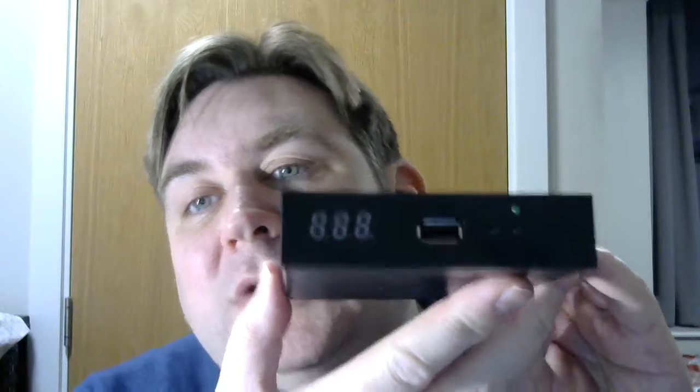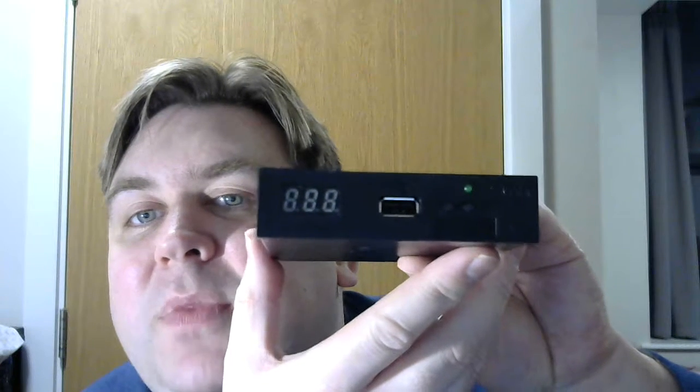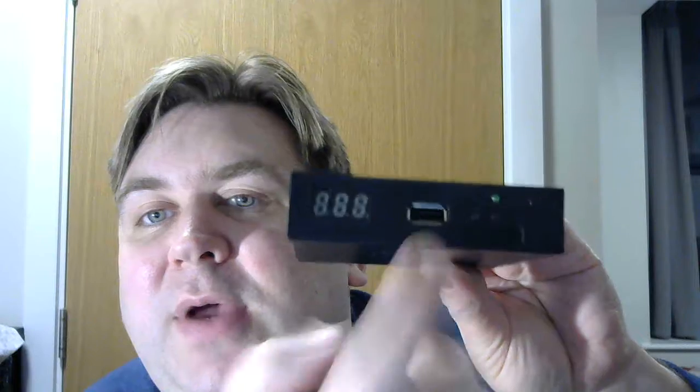This is how the GoTek floppy drive emulator always is. The camera isn't showing it too well because it's all black, but Phil's Computer Lab has some good videos on these. I'll walk you through it on my channel anyway. It has a USB drive — I'd recommend you get a good USB thumb drive for this. I've looked for one in particular because I know they're recognized by everything, they boot natively from the BIOS, and they also have an LED indicator light so you actually have an activity light — very useful.